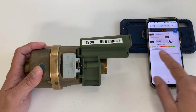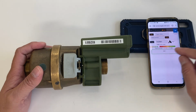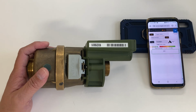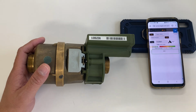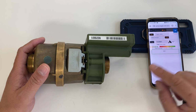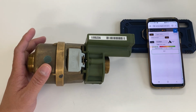And also, we recommend that 4 out of 5 transmissions is the least number of receptions you get, unless, for example, you get 71 and then you only get 2. Probably that's good. Probably there's something in the area that needs to be fixed. But for now, I think we should go for 4 out of 5 at the very least transmissions received, and negative 130 and below for the signal.